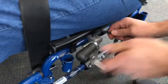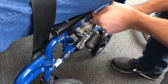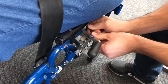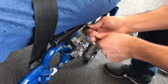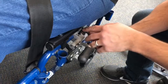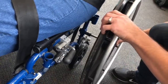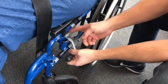We're going to need an Allen wrench to take out these two set screws right here. Oh, there we go. I'm just going to loosen these two up. There we go. Good. Now I'm going to go ahead and attach this wheel again. I took the wheel off so I could easily access the brake to make sure that I could get these bolts off really easy.